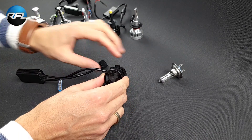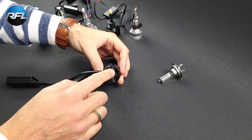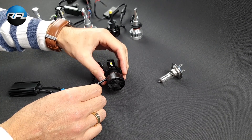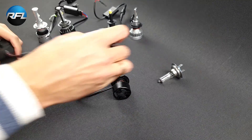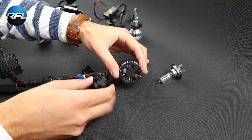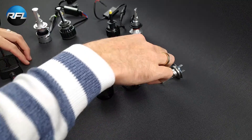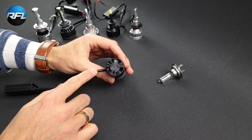Most important is that it's very small. As you can see, all LED bulbs have a fan to cool the temperature of the LED so it has maximum light output. But this one is very small. Comparing it to an earlier version already on the market, this diameter is much bigger — 41 millimeters — while this one is only 31 millimeters. So this will be much easier to mount inside the headlight.